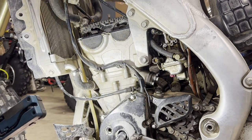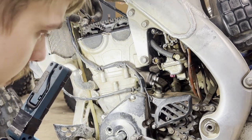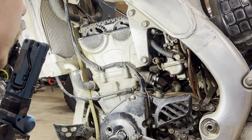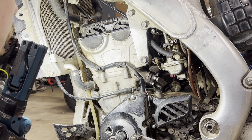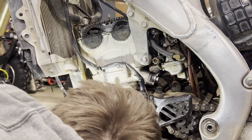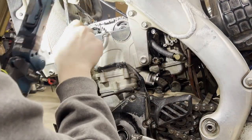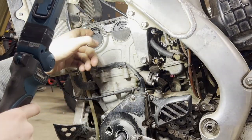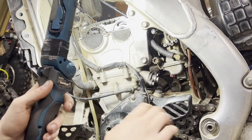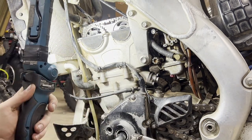Okay, we just stopped. I think we're having a piston-to-valve contact issue right now, which is not a hundred percent what I want to hear. Yep, we've got contact - the exhaust cam is almost in time, assuming the top mark is supposed to be 90 degrees with the deck of the head and the side mark is almost parallel. The decompression lever seems to be working but is a tad loose. So we're gonna pull these cam caps off, get the cams out of there, and see if we can time this engine.